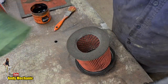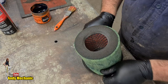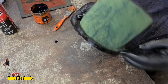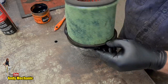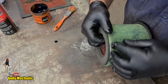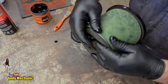Next job is to reinstall the air filter element - the foam element that we've cleaned and re-oiled. Super careful, we don't want to rip it because we've got no spare. What's important is to make sure it's tucked into its little lip around the top. It's probably stretched a little bit from all the working we've done, but we should be able to get it in there okay. We need to make sure it's in that metal lip there, because if it's not in properly, air can bypass it.